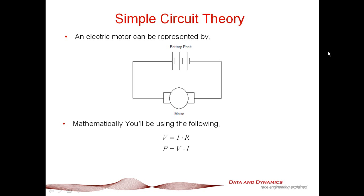I can tell you right now, without the combination of their experience and the fact that I've been working with RC electrics for so long, I would have been completely lost on this project. But the key — the first step in understanding electric powertrains — is to understand that an electric powertrain can be represented by a very simple circuit diagram: basically a battery pack and a motor. It's effectively a resistor hooked up to a battery pack. That's all it is.